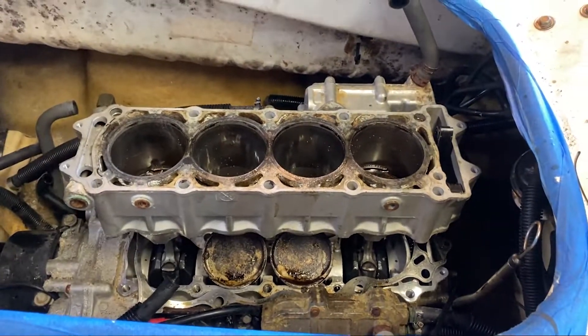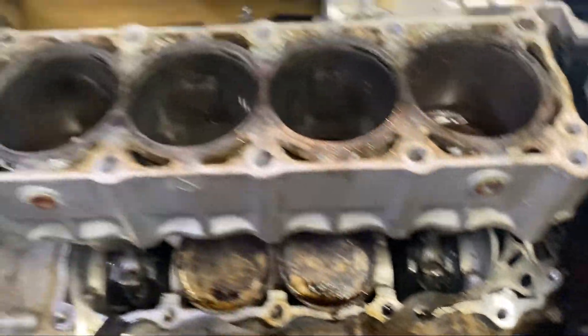I'm going to get that all done when the parts come in tomorrow. But this is going to conclude part one of the STX-15F rebuild - top end removal. That's how you do it. Going back is actually the same way, you just got to set timing. That's why we have to pull this motor out - we can set the front cylinder to top dead center and do it that way, but it's much easier if you just pull this all out. It would be extremely difficult to do it with it in there. So it's really just a couple more bolts to take this motor out. Next time, we're going to take the rest of this out and start the rebuild.